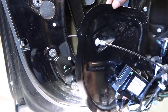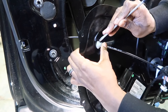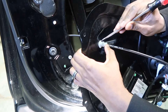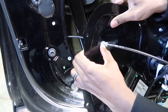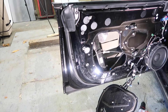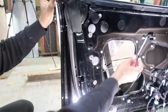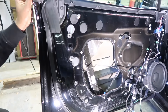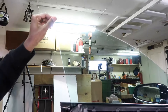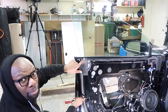Now that this is off, you wanna get this complete panel down a few inches. Let's get a flathead in here just so we can pull that through a little bit more and get more clearance for this job. Now here's a neat little trick — what you wanna do is get the window position as high as possible so you can get access to some screws in there. You wanna trick the window into thinking it's closed by getting a flathead right here and pushing it in all the way up.